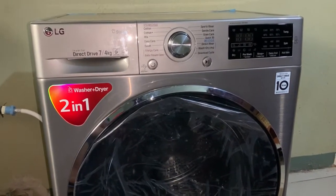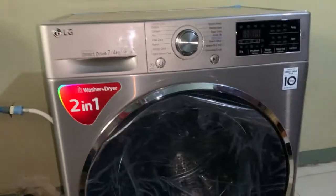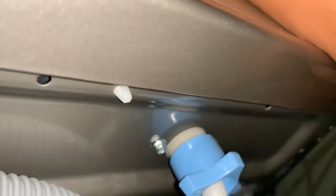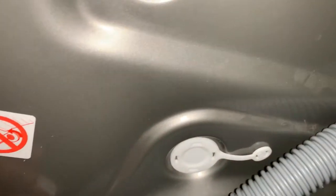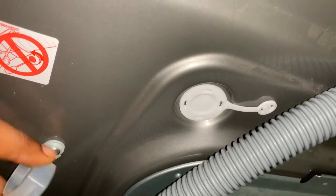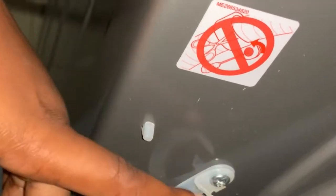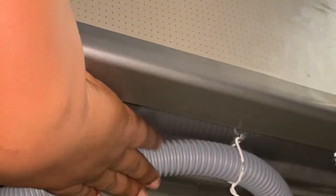For the installation, if you were using a manual washing machine before, the hose and water inlet are quite different. The water inlet and outlet for automatic is quite smaller than that of manual. This hose is supposed to be hanging here — I used scissors to cut it thinking it should lie on the floor like a manual machine, but it's supposed to hang. The effect of not hanging your water outlet hose is that your washing machine will not retain water, and if it's not retaining water you can't wash.